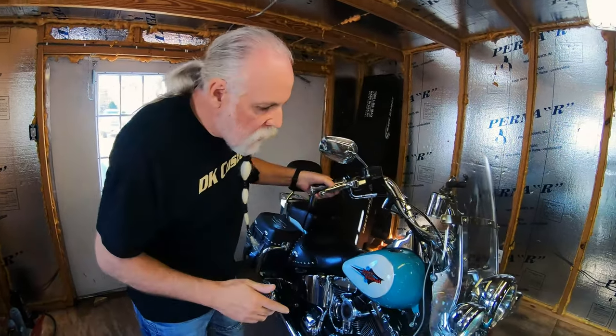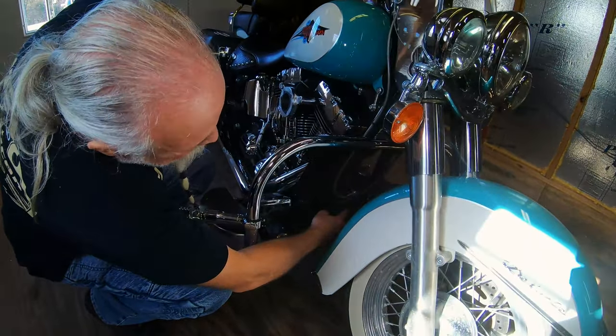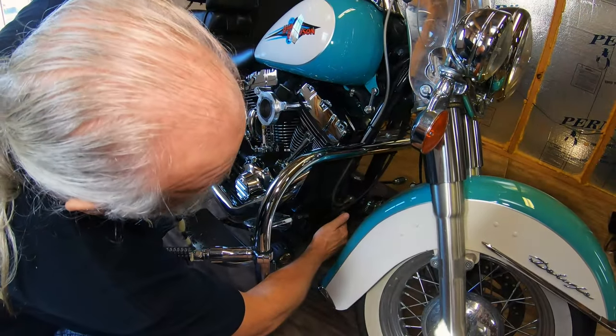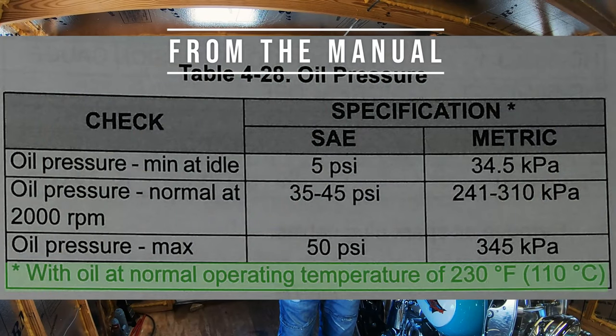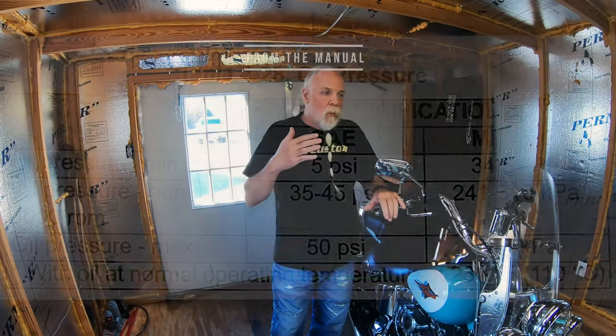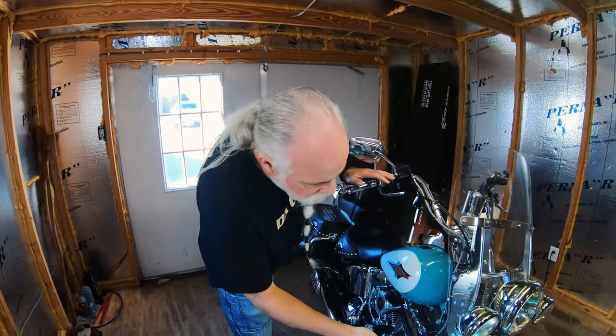So why are we talking about bikes with ABS? Up until the M8s, which got introduced in 2017 for the Touring models and 2018 for the Softails, when Harley put ABS on a bike the ABS module is right here — there's your regulator and here's your ABS — so all this space is taken up on the ABS bikes. Bikes with no ABS have room for a cooler there, and all the twin cams need an oil cooler, but if you have ABS there's no space to put the oil cooler in the traditional location.